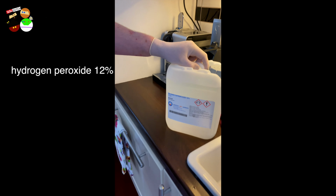If this works, what I'm going to do then is get this casing. It doesn't look like that now, but this is very yellowed as well. Extremely yellowed. Look at the back. Do you see the color? Even the front part is not that yellow, but I will do it anyway. For that, I'm going to use the cream peroxide and then seal it in a bag and use it with the sous-vide technique as well.